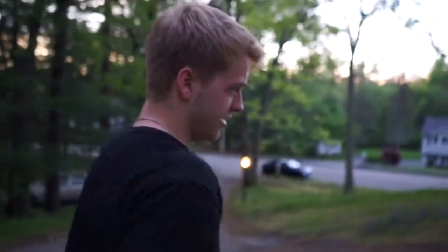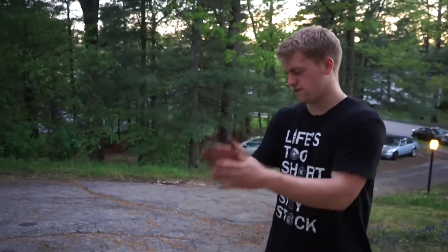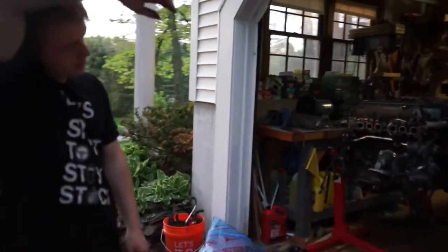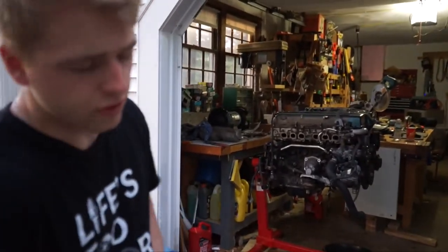Alright, let me update the viewers. Let me just bring you over here. We've got our old oil pan right here — this is a front sump oil pan. I won't be needing that because I need to go rear sump, which is now currently on the engine. Pretty much what we did today: we swapped out the oil pan from front sump to rear sump. Just a little process.